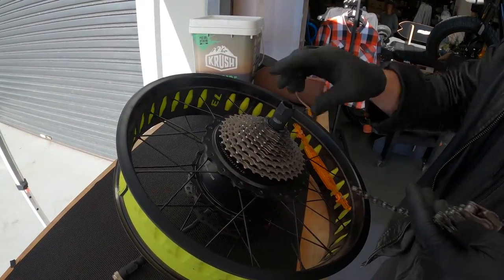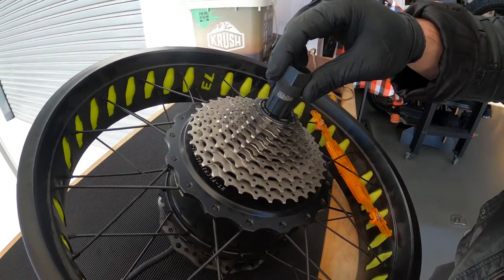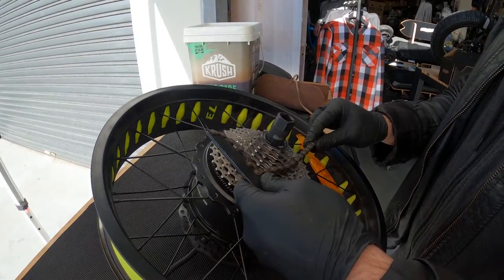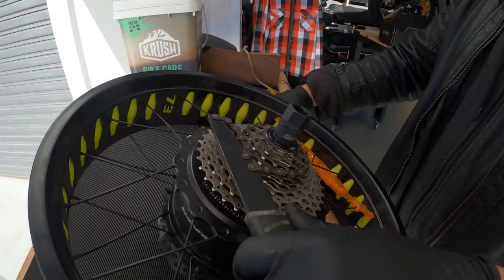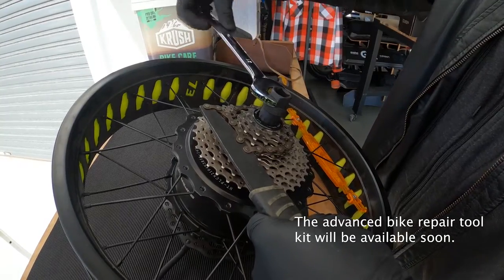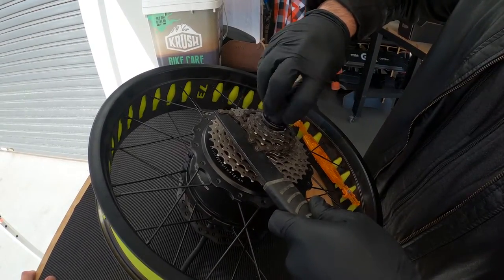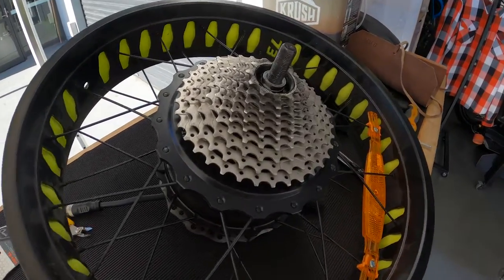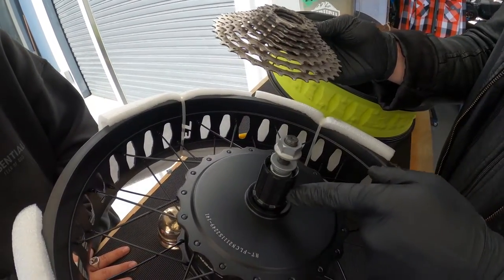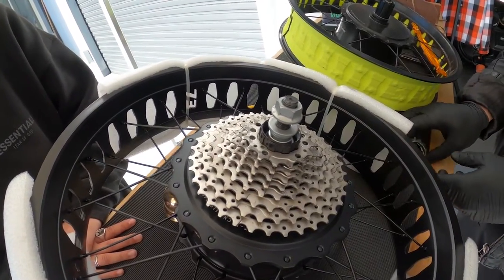The next step is to remove the cassette from the rear hub. What you'll need is a cassette remover — we'll provide the name and sizing down below. It does still use the size 21 wrench. The cassette tool as well as the chain cassette holder will come with an advanced toolkit. It might be very tight at the start, so gently remove it and unscrew it. At this point you want to prep your new wheel and remove the cassette. Now match the skinny spline with the skinny spline on the cassette — the last two should pop on the same way.